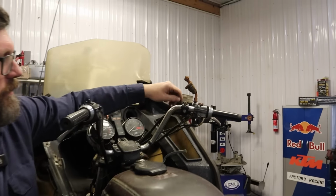Okay, this might help. There's a bolt here with a cover. Uh-huh. This bolt cap, let me take it off. In behind that, I'm thinking is our crank nut. So hopefully I can get a socket on there and start working this thing back and forth and get this motor broke free.